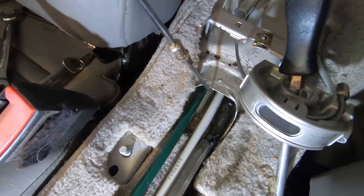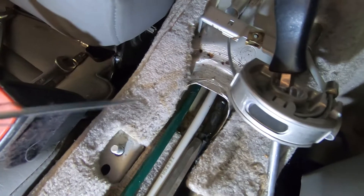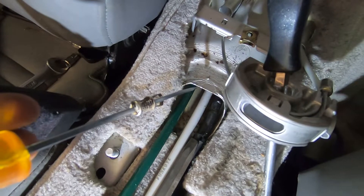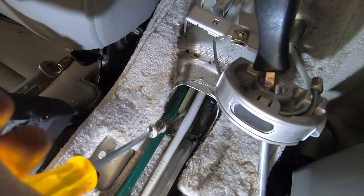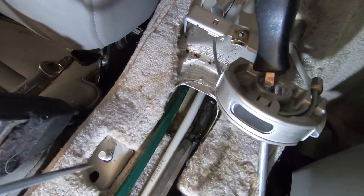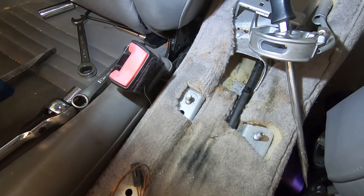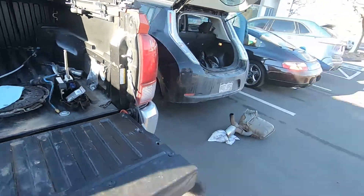There's a rubber grommet there — that was a pain. Don't try to knock the top; it needs to go back out from the bottom of the car. I was trying to hammer the top and that was doing nothing. Once I started hammering the bottom, just hammer the bottom all the way and it'll push out. I got the cables out — that grommet was the worst. Just hammer on the bottom, not the top, and it'll push out. After you get the grommet out, it's pretty easy — the cables just pull out from underneath. I sprayed a simple green and water mix, just a soapy mix, all around the grommet to lubricate it, and that seemed to work. Thanks for watching — I hope this helps you remove those shift cables from your Porsche 996.